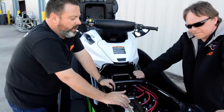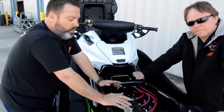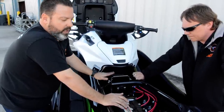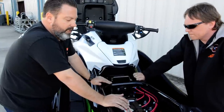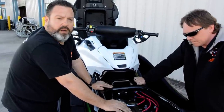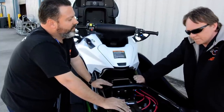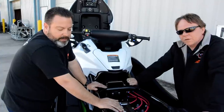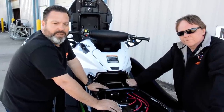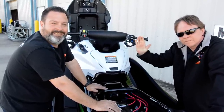Hopefully this gives you a really good start on some do's and don'ts. Keep that jet ski clean. Flush it if you're riding in salt water. Be sure to fog it, especially if you're in a coastal area where you have the salt air — fog that jet ski every time you ride it. Keep them clean if you can, store it in the garage, keep it covered from the elements and you'll get a lot of service out of your jet ski. Jerry, thanks for sharing all that great knowledge. If you have any problems or questions, Jerry's our service manager here at Mainland Cycle Center — give him a call at 409-948-4969. Thanks for watching.